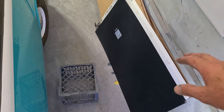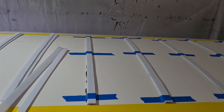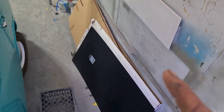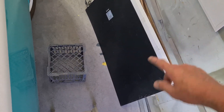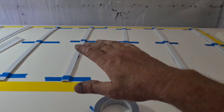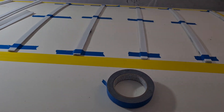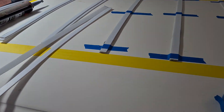When I say how I'm doing it, this is how I am doing it - I haven't fitted a flex panel before, so I did my research as they say. You get a lot more life out of the solar panels if you can get a bit of cooling air underneath, because it's pretty common for people to just put some glue on the back of the panel and just slap it on. But you want something that won't rot, and it needs to be waterproof.